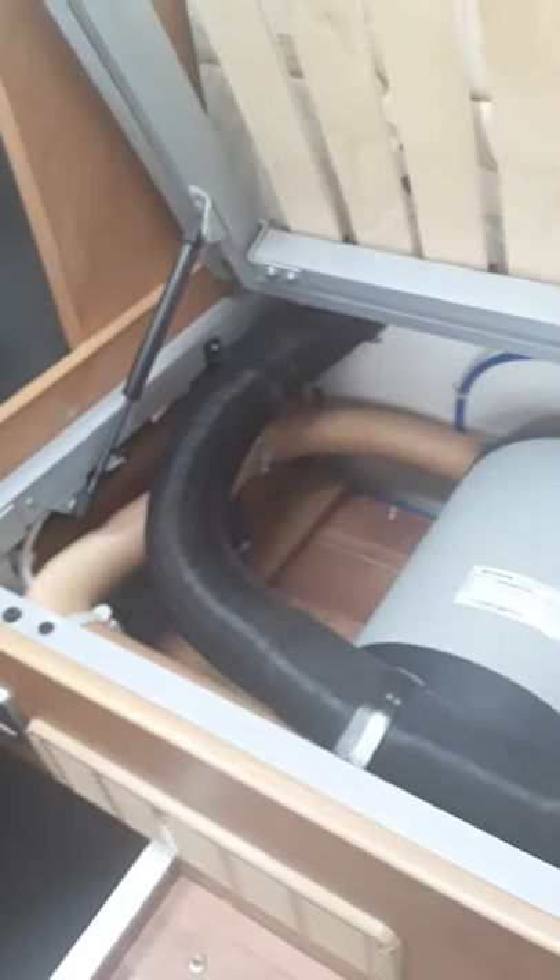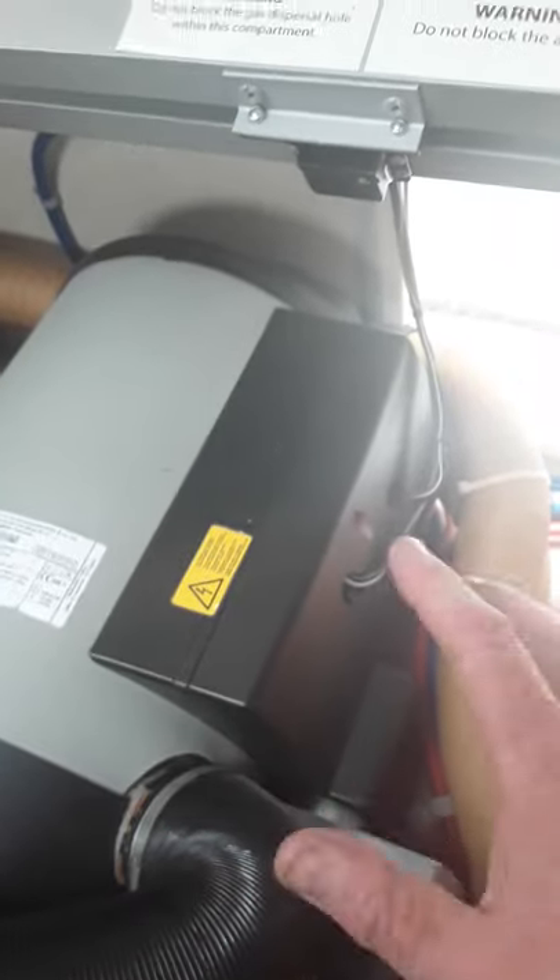What we're looking at here now is your actual heater, just in behind the driver's seat — it's just under the seat behind the driver. You can see you have a pump here — that's your water pump, and that's the heater itself. The thing you're really going to have to go at — and you can access this with the door open outside — is this little yellow valve, and that's your drain valve. What that does is drain the water out of the boiler itself. Whenever you want to get in the cold weather or drain the van, you open that up.